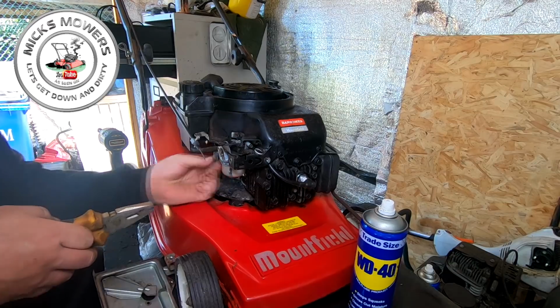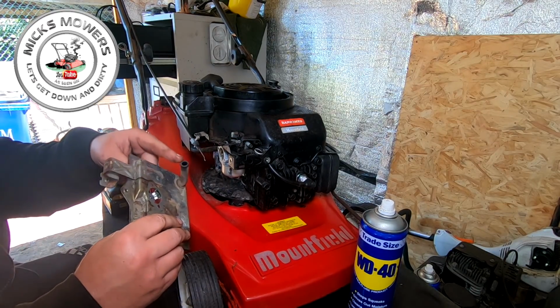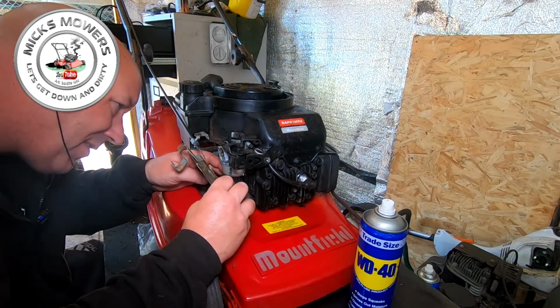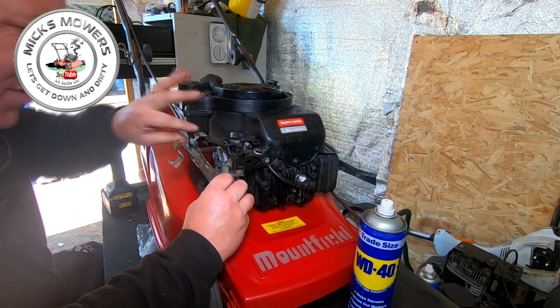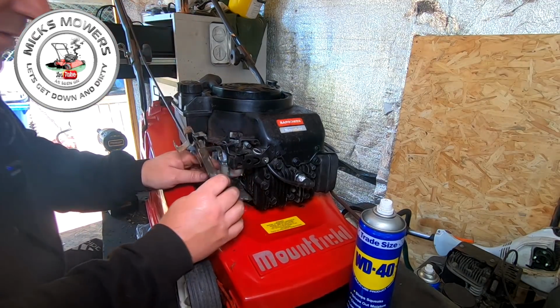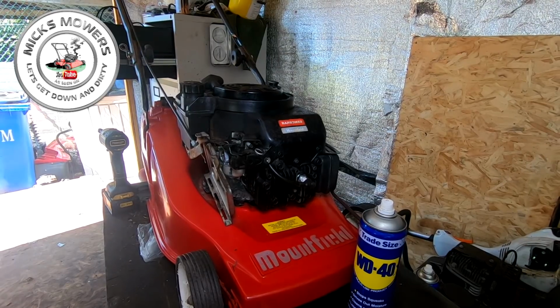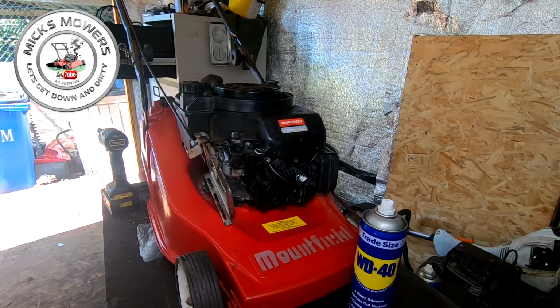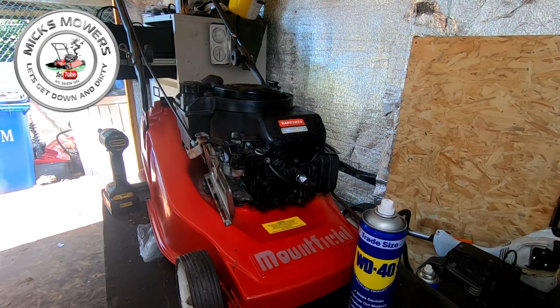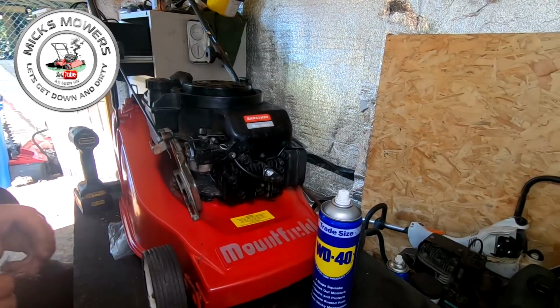That goes onto there. Backing plate, crank breather pipe goes onto a crank breather there. Stick him on first, and just rotate the carb on into place. And that's all going to sit there. I need a gasket, which is on the bench. Mustn't forget Mr. Gasket, because they do need them. Otherwise it'll have an air leak. I did rescue that out of the cleaner. It was having a bit of a swim.